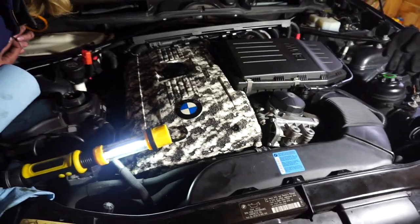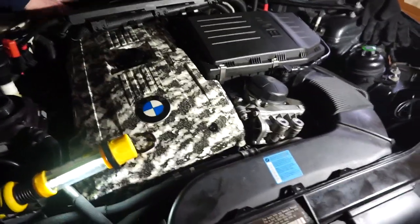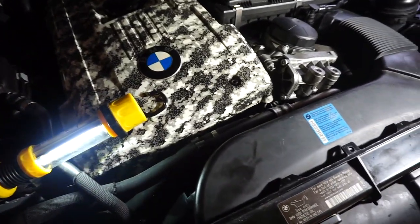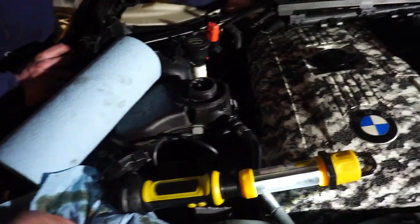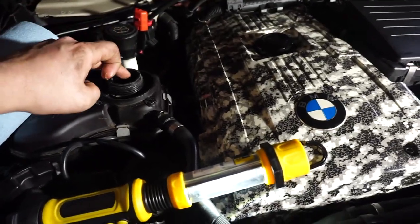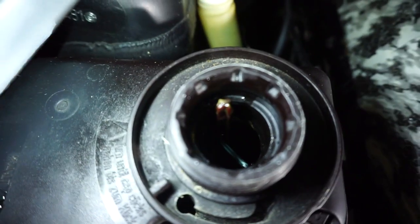After about 10 minutes, it'll stop making noise, and then it is fully bled. And then you might have to add coolant. Oh yeah, you can see there's a little bit of oil in there from the gasket leaking. You want to add coolant so that the bubble sticks out a little bit. She's really going now, huh? Mm-hmm. Oh, yeah. It's not in focus. There we go.